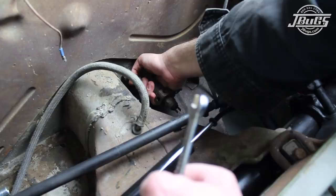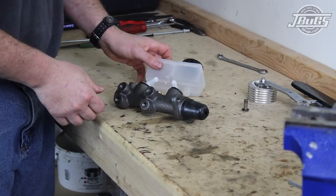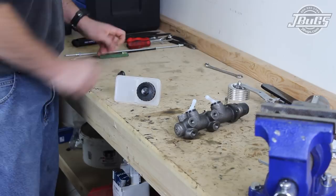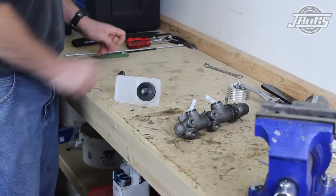Now at the workbench, we can prep our new master cylinder for installation. We're going to be installing an MP dual circuit large bore master cylinder in place of the stock single circuit master cylinder. Since the original reservoir only has one feed line and we need to supply two circuits, we'll use a direct mount brake fluid reservoir and fill it with the stock reservoir. We'll use a knife to open up a hole in the top of the reservoir for an early master cylinder grommet.